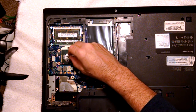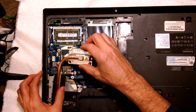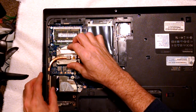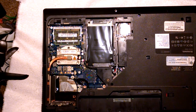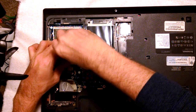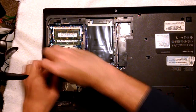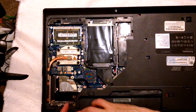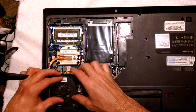That should be enough thermal paste there. Now that we've got all of that done, let's go ahead and set everything back in. Just ease it in — you do not have to manhandle it, as I say. Now let's take our fan and set our fan back here.